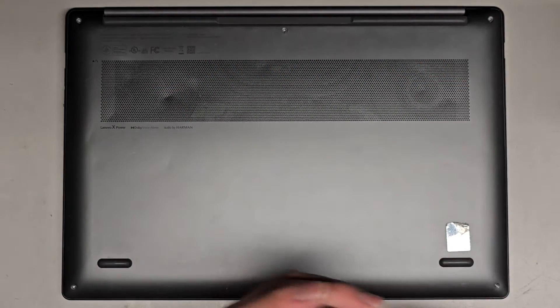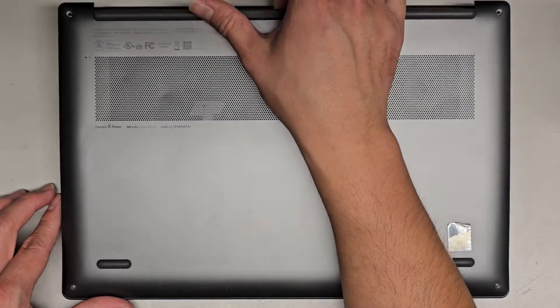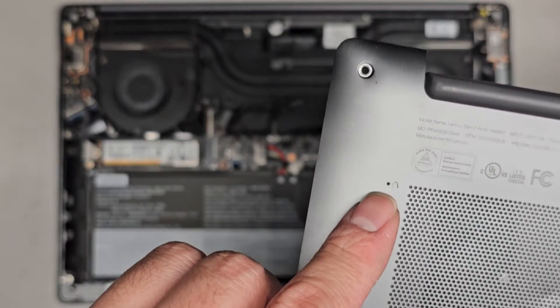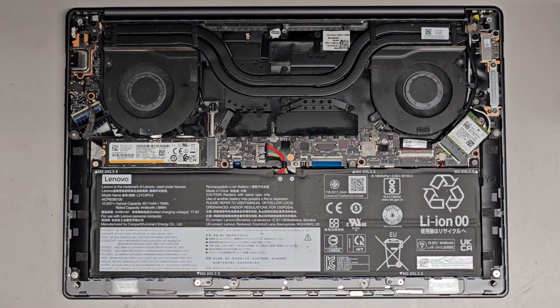Last one here. Now to get the bottom off — most likely we'll use a suction cup, or actually you just pull it up like that. Also on the bottom, there's this little hole here that lets you do a kind of battery reset. So if for some reason your computer's just not turning on, you can try using a little needle, pin, or folded-out paper clip to press and hold that for about 15 seconds to drain any residual power. Sometimes that will get it to where the computer will start up again once you plug it in and power it on.